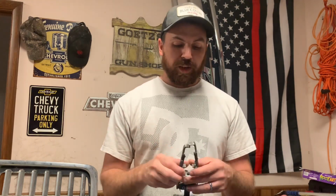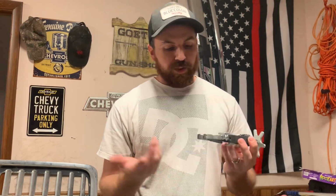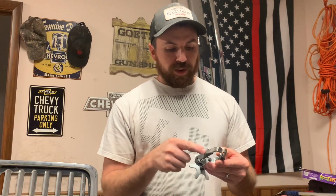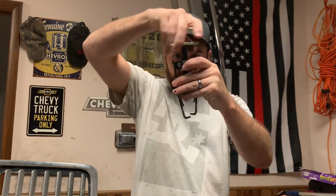So I needed to use it on a Detroit or something. I can't remember. It's probably been like 3 or 4 years now since I've done this, but I found a bracket, an angled bracket. I can't remember what it was from, but I sliced a couple little arms off there and welded them to the existing arms. I cut the feet off the existing arms on here, and basically just used these as the new feet, and used the longer feet on there to compress the spring, and it worked pretty good.